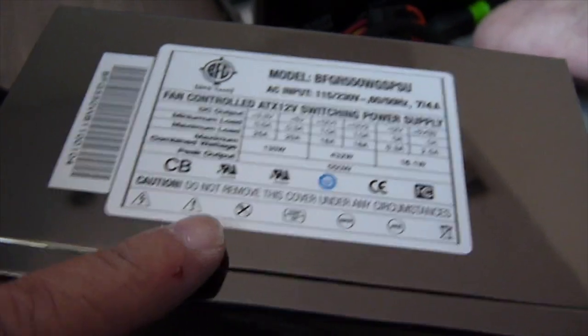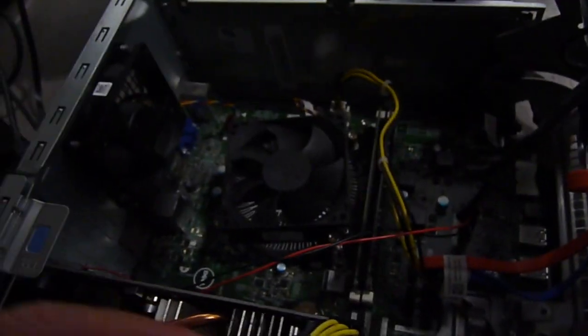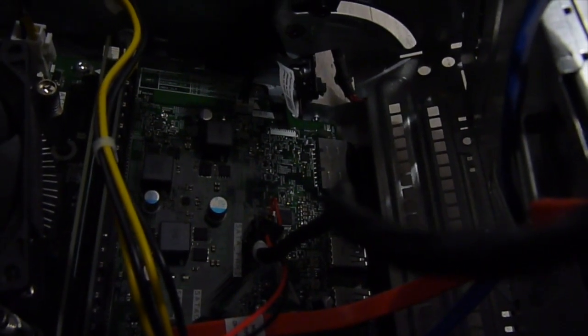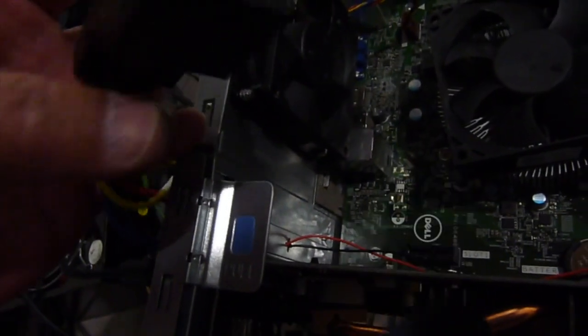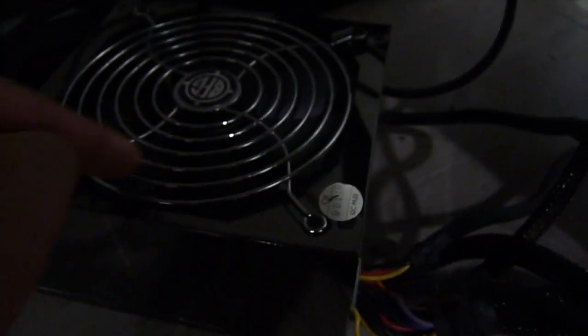I finalized with the 550-watt BFG power supply. We're going to use a separate power supply just to drive the GTX 1060, and when we push the power button or turn off the computer, the external PSU also turns off. To do that, we splice the 12 volts from the hard drive SATA connector — this 12 volts comes on when the computer powers on and energizes a 12-volt relay I got from the auto parts store for about three dollars.